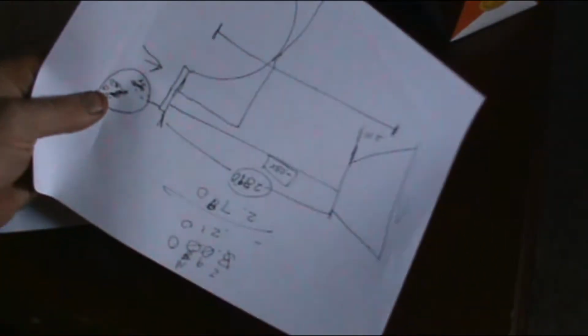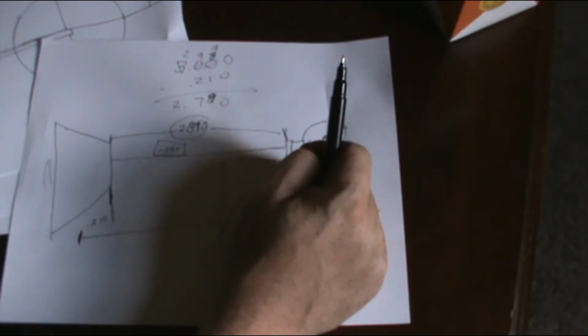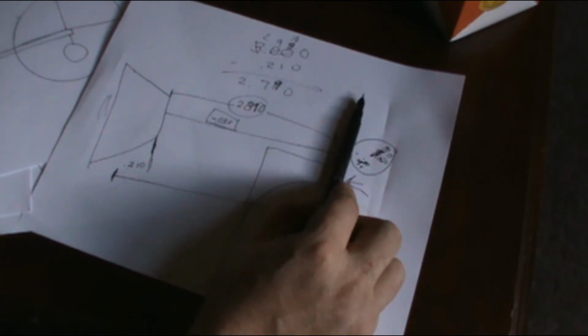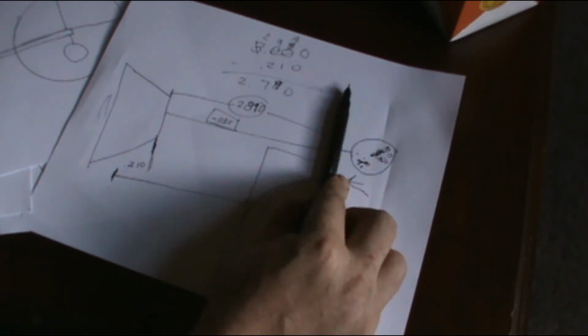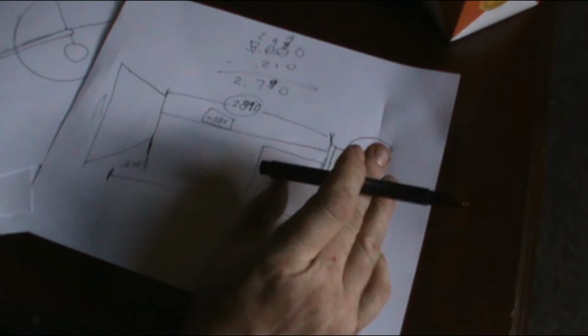Plus, I also think that with this tool, where am I going to go back in my, actually it's probably this one, Myriad of Drawings. Yeah, this one. When you are holding this, because you're only going to use about 2 fingers to do it, this has a lot of flex to it. You have to be really careful and precise with it. You don't want to do this or that, but I'm pretty sure that you could be off a couple thousandths one way or the other just by holding it there. So I would not stress if you cannot get your measurement perfect.